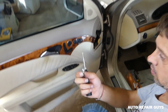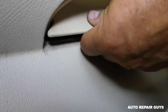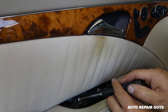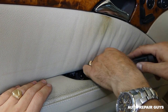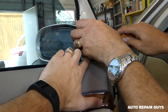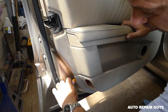You can see the size of the screw now. Next, we need to go underneath right here and remove that cover — just pry it open, it has a few clips on it. We have two screws to remove here with the same flat screwdriver. Next, we need to remove the cover for the mirror tweeter right here — just push it towards the back and it comes out. You don't even need to unhook the tweeter.